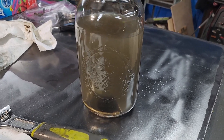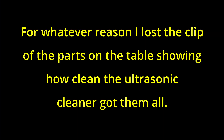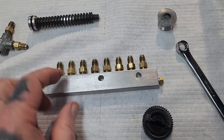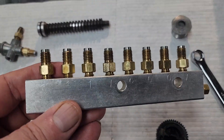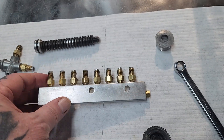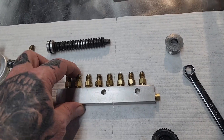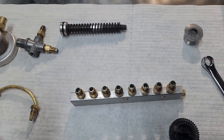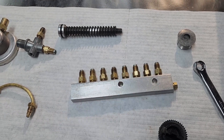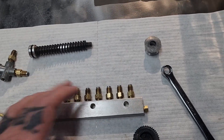We'll go ahead and get those parts out of there and see what they look like. I got them together — each one is with its corresponding number. That's the plug end, that's the oil supply end. You can see I put an arrow there. I air tested it and I'm getting a very good volume of air out of each one of these, which wasn't happening before. So that ultrasonic cleaner cleaned them up. We've got ten of them, so we saved at least 100 bucks right there.